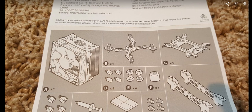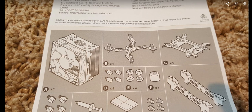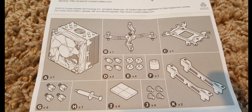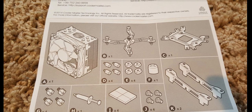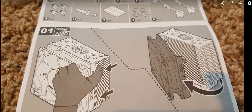After the time-lapse, here is picture one from the instructions showing all the parts included in the package. If you have an Intel socket 1150, not everything is needed — some parts, like certain plastic brackets and screws, are only for an optional extra fan. Thermal paste is also included, so you don't need to buy anything extra.